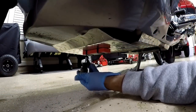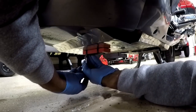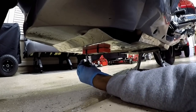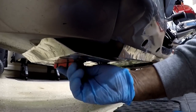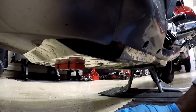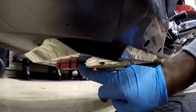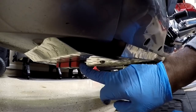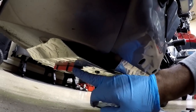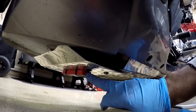If you have a belly pan, great — if not, you've got to find a spot on the bottom of the motorcycle to mount it. Now that I have the magnet installed on the bottom of the belly pan underneath the Gold Wing, I don't have to wait for a car to pull up to change the traffic light if that light has an induction loop detector. The magnet on the bottom of the Gold Wing will interfere with the electromagnetic field on the induction loop and it will change the red light for me — so no more waiting at the red light.